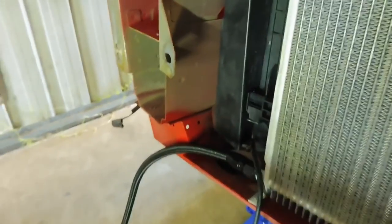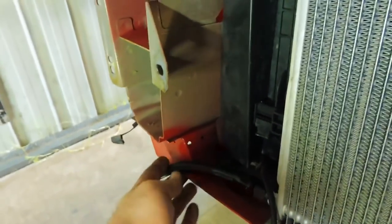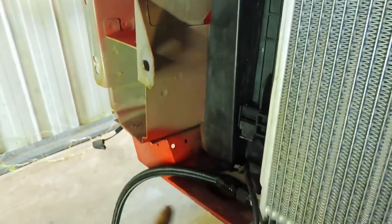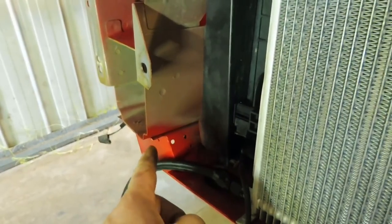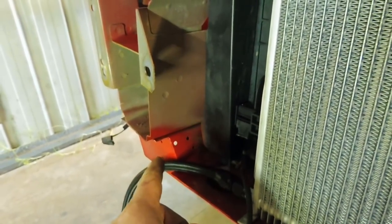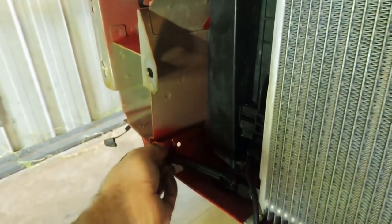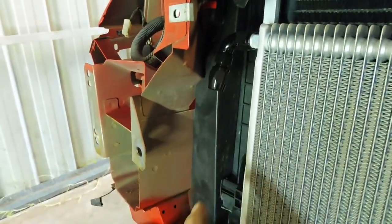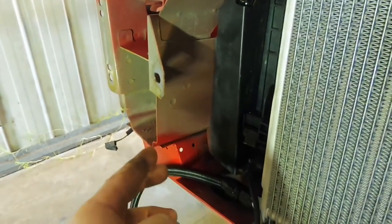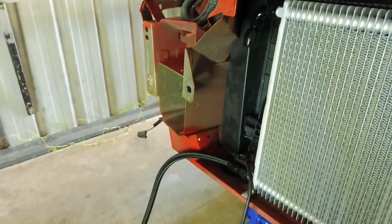You can see where I've clearanced that lower radiator support so the braided lines can come straight through there and have a nice straight run. If they went outside around the edge it would be a sharp edge for the line to rub against, which is no good. That'll allow me to go straight through there and put a P-clamp on the front, and another P-clamp to hold it in. Now we'll look at making those lines up.